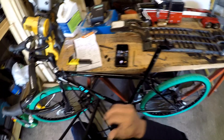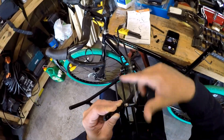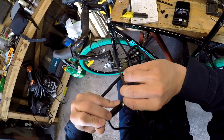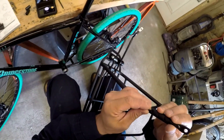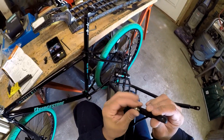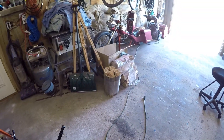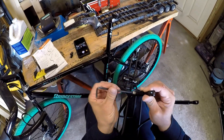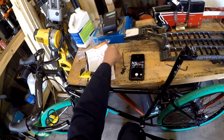There are some pretty nice looking screws on there. They're four millimeter? Yes, they are. We'll get that snugged in there. They have three holes on here so you can put it in the one that's appropriate for the height you want to be — it's completely adjustable, about an inch and a half of range. This is a 26 inch wheel, a 559 if you're into that sort of thing, but I only have a one and a half inch tire on it. If you put a larger tire on there, you'd need to use these other holes anyway. It advertises fitting up to a 29 inch bike.